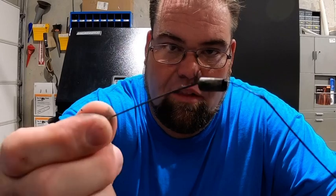I want to show you the throttle cable on the trimmer that we just replaced. See all the fraying on there — it wasn't allowing the throttle to go all the way up from the carburetor. It was getting stuck right there on all those little broken-off pieces. The trimmer works great now. It took about 10 to 15 minutes to go through and do all that.